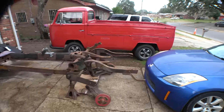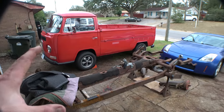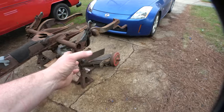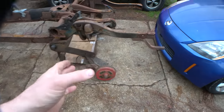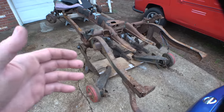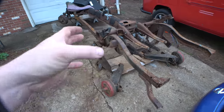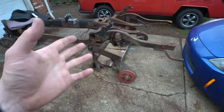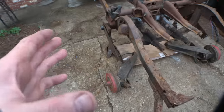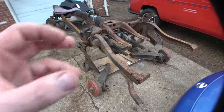I want to build this thing up to be off road — I want something big and exciting. This is a Volkswagen truck and you know how tall they sit; they sit pretty high. Being that this is also a bus, it's going to sit at a similar height. We're going to jack it up even higher — I'm going to raise up the front suspension, might even reposition the axle beam. The spring plates are adjustable and you can bump those things way down. These are not the final trailing arms going onto this bus; these will be the ones I start out with. Down the road I'd like to get — although they're expensive — some three by three trailing arms that are in my wish list. They're three inches longer, three inches wider, making the whole thing even bigger, so less adjustment is required at the spring plate to raise it up even higher.